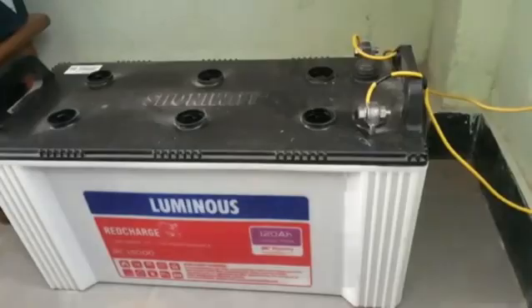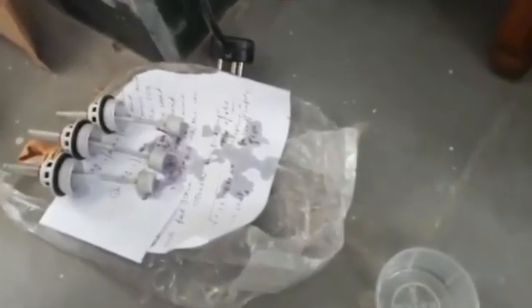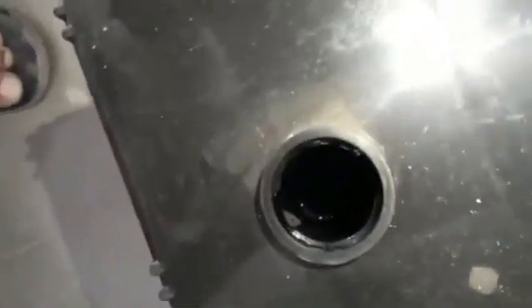Keep the knobs safely and do not touch the acid inside — be careful. This battery needs some distilled water; you can see that about two inches of water will be required. When you pour, leave a little bit of space on the top — don't fill completely.